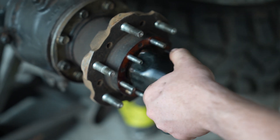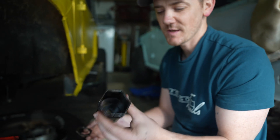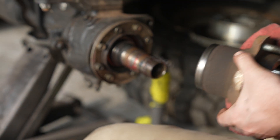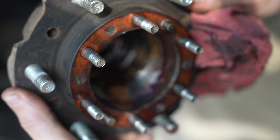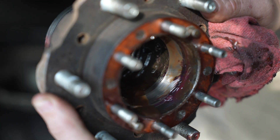If you remember from the other video, I ended up using a screwdriver and hammer because I didn't have this particular socket — so it's really nice to have it now, and it'll be getting added to my trail kit. If you'd like to see a video on the different tools I carry, make sure to comment below. Here you go — nice, oily, greasy, nasty mess. We'll go ahead and repack those bearings and clean this out really well.